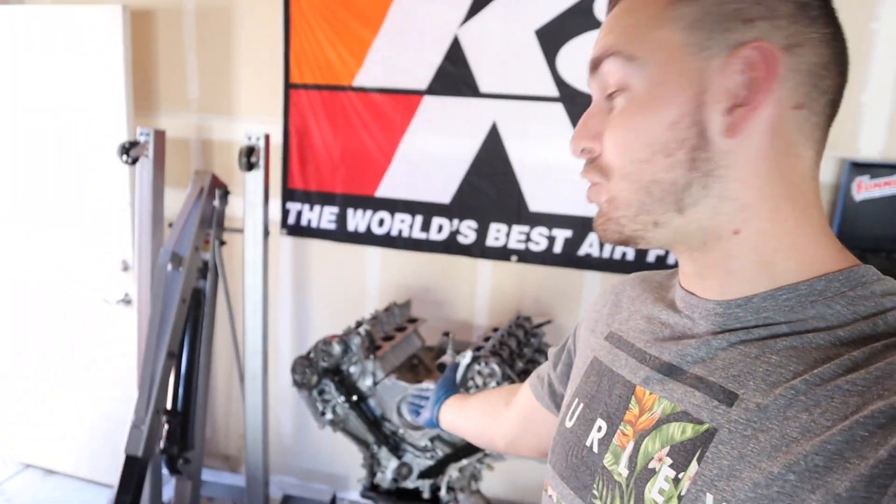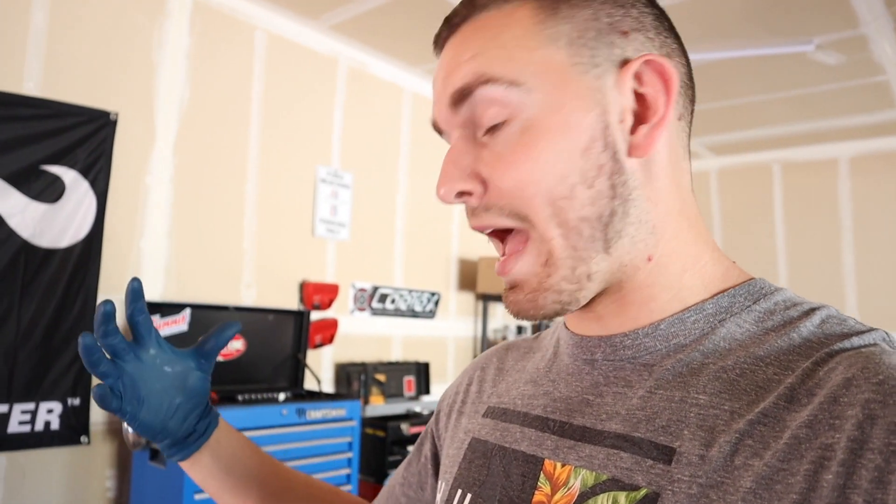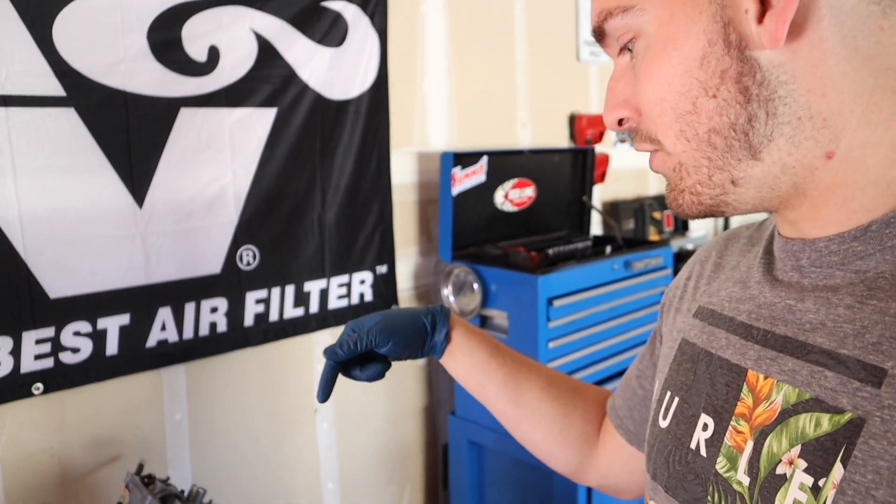What is going on YouTube, thank you guys for watching today's video. This is pretty much just going to be a follow-up of what I did in the previous video - stripping down the coyote motor. Everything that needed to be done in the prep phase is already done. The last thing that needs to be done is dropping the oil pan and getting the oil pump gear housing out. In the future we are going to be tearing the whole thing apart. As I showed you guys in the previous video, all of the cylinders have some debris in there - I'm not sure how it got in there, but it needs to be dealt with to move forward in this process.